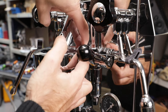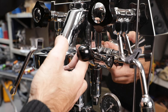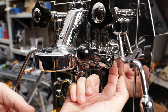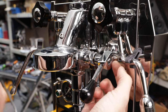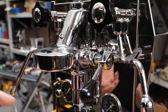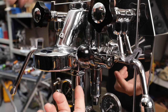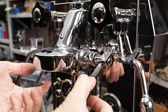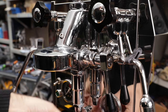When you've finished your shot, the lever is in the downward position. That means the pressure from the puck can escape through the group and down into the drip tray through the exhaust valve. In the upward position, the valve in the very bottom is closed. The top one can operate under spring pressure, so it can be charged by the positive pressure of the pump to saturate that pre-infusion chamber, but it is closed to low pressure. The valve allowing water in from the heat exchanger through the mushroom in the top of the group is open, so positive pressure from the heat exchanger can flow into the group and start to saturate the coffee. Also in this position, we've actuated our micro switch, which means the pump is running. There is a position midway where the mechanical valve will be open but the micro switch isn't yet open, which will allow - if the machine was under mains pressure - a lower pressure pre-infusion without the full pressure of the pump. When we end the shot, we are closing the top port and opening the bottom port to allow that pressure to vent through into the drip tray.